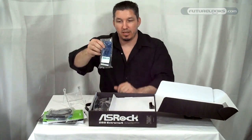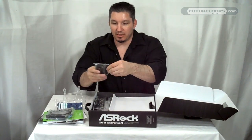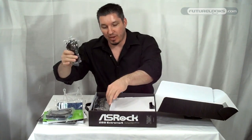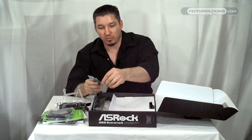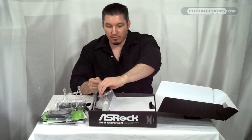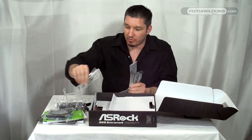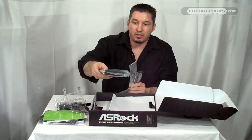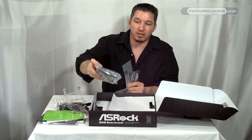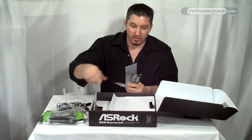And the ever-so-legacy floppy cable. We've also got four SATA cables — these are backwards compatible, SATA 6 Gbps or SATA 3 Gbps, it doesn't matter. A male-to-male audio cable for a little extra connectivity. Now this PCI bracket can replace the 2.5-inch drive tray — you can take it off the connector and put it on the back of your system to take up a PCI slot instead of a case slot.